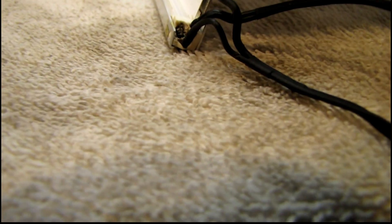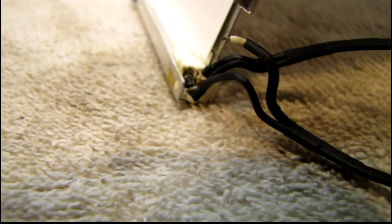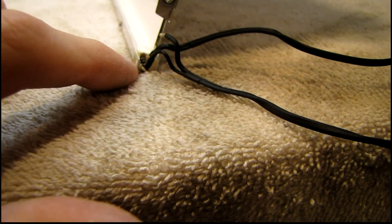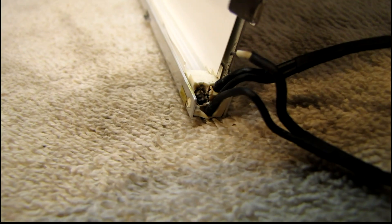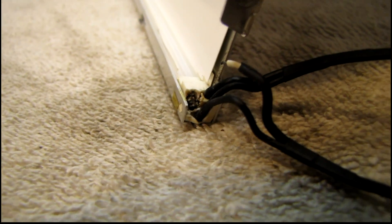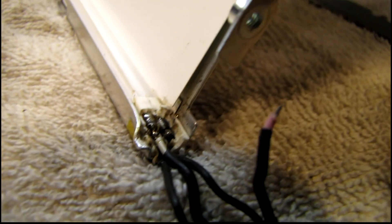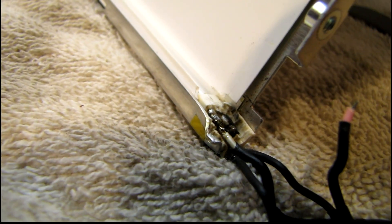This is not going to be fun. It's pretty burnt — I don't know if I can even get some fresh metal on there to solder the wire back on, and it's probably going to short to the other one even if I do. I can't take the CFL out of the assembly because the other wires go back behind that metal plate. I guess I've got to keep digging out the burnt stuff to see if I can expose some fresh metal on that end of the CFL. I just barely got one attached and the other one breaks off.